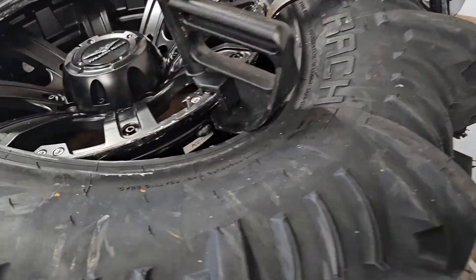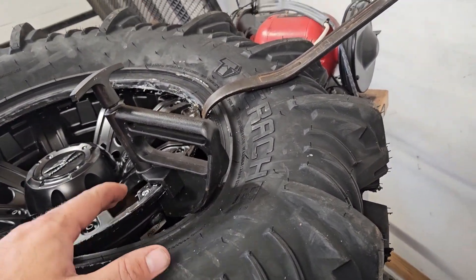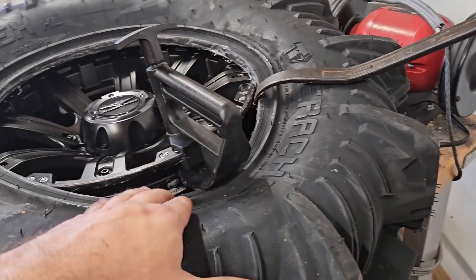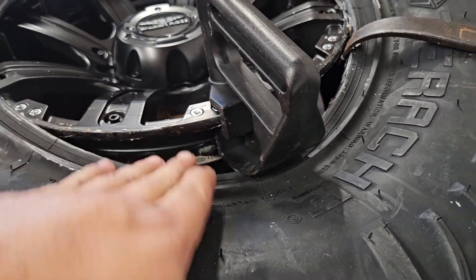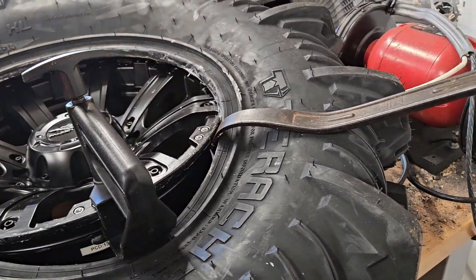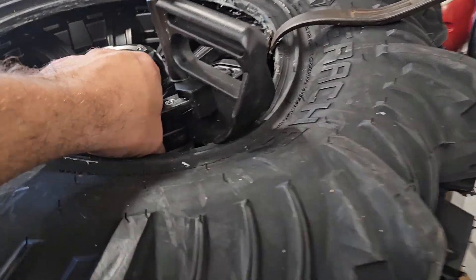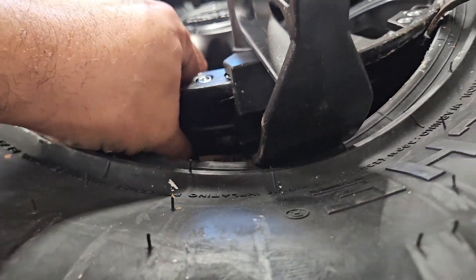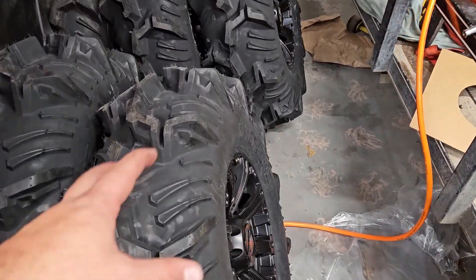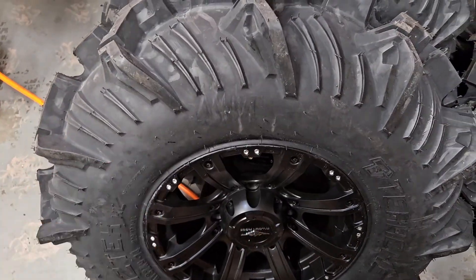This is really one of the best tools I've bought in a long time for mounting tires. I usually do bead locks so it's not a problem, but this is not a bead lock, so I'm actually having to use the tire iron and put in some elbow grease. With this tool, you lock it down in there — number one, it protects your valve stem because the tire will slide right past it, and it keeps the rim from sliding. Now I just start working in one direction, it will pop right on, and this will help it slide into the deep part of the wheel. This tool is so nice for mounting tires by hand. These are some tips and tricks on how to get a tire beaded onto a shitty wheel — a non-bead lock or a wheel that doesn't fit right like this one.